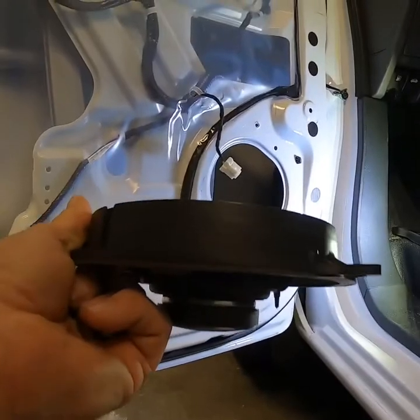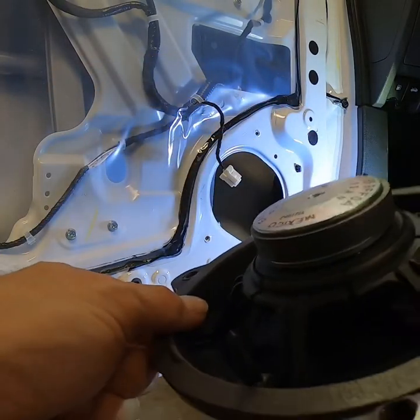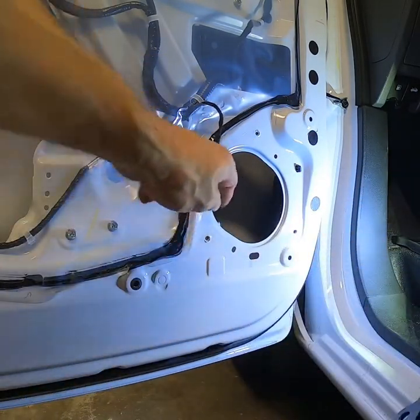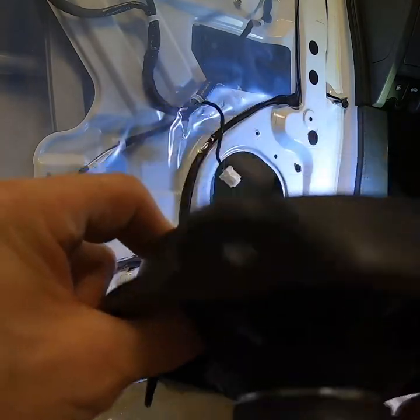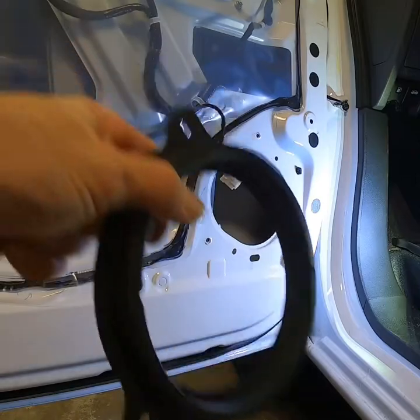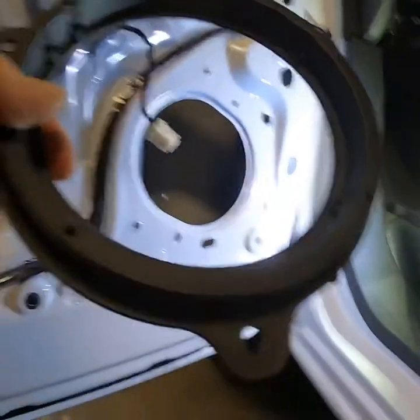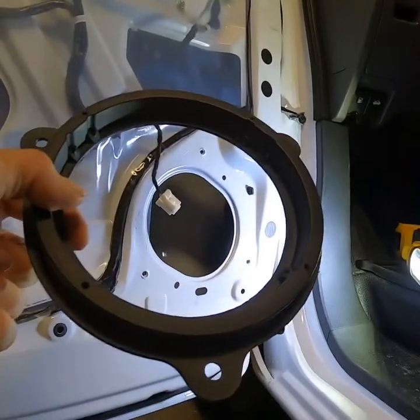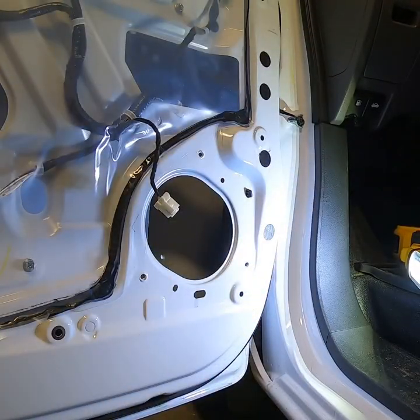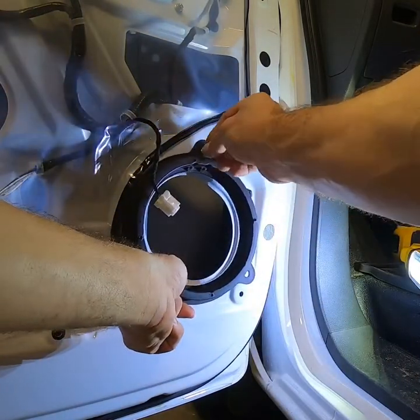As you can see, there's a mounting bracket here. If you put a regular speaker in the door, your magnet's going to hit the window and you're going to have problems — so don't just drop a speaker in the hole. Get online and buy a speaker adapter. Here's my Nissan speaker adapter — this is for a 6.5 inch speaker. 5.5 inch speakers are available too, but you can actually put a 6 and 3 quarter inch in here, which is what I'm going to do today.